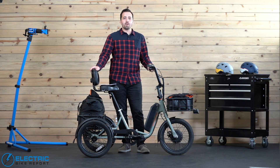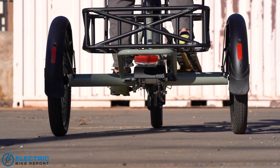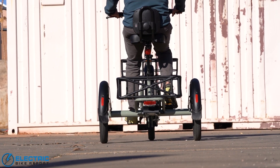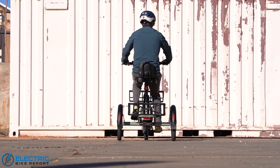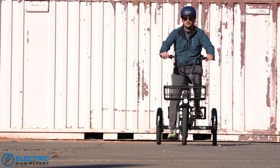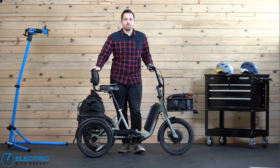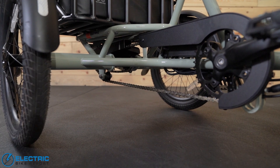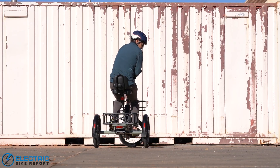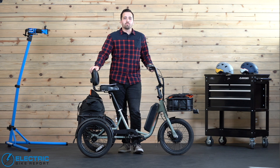Overall the Rad Trike handles fairly well as long as you keep it within its limits, and Rad set it up for success. One thing you must account for in trike design is the single-axle problem: if both rear tires share one axle, they rotate at the same speed, making the trike tip-prone, because the outside wheel needs to travel faster than the inside wheel when cornering. Rad solved this by setting up a freewheel on the left side — the drivetrain only ties into the right wheel, so the left wheel can spin as quickly as needed. It's pretty good engineering and results in a safe-handling trike within its parameters.